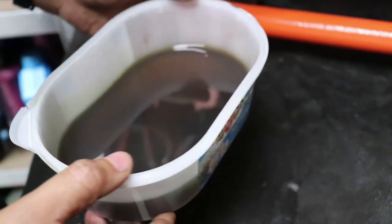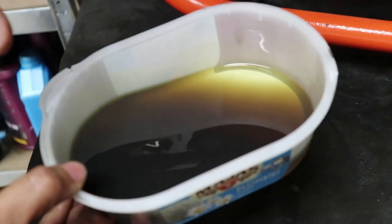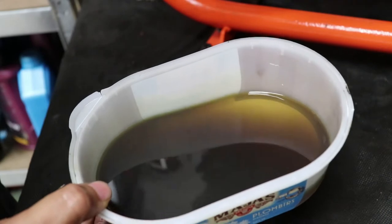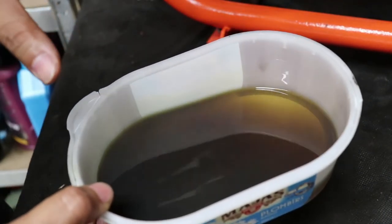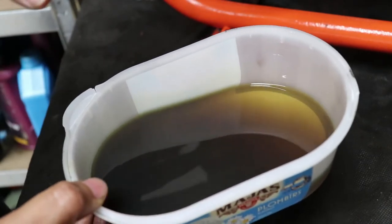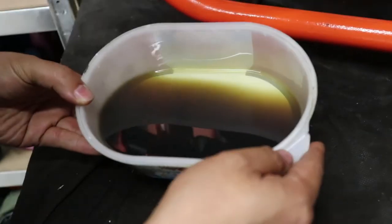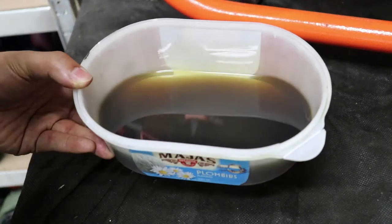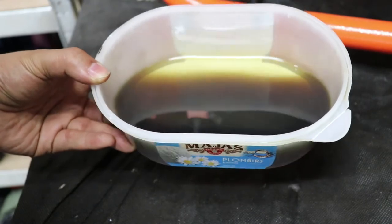The color should be normal black without any contaminants. Such as if you have very high mileage, the oil could be mixed with some benzene, or even with a little water, which I'm going to show you next. So if your gear oil drains out as a common normal black like this, this means that your Vespa is healthy.